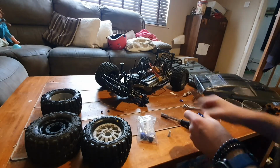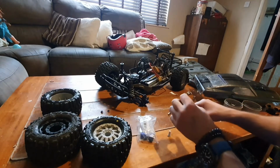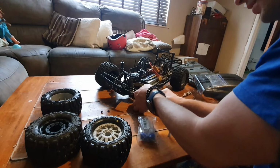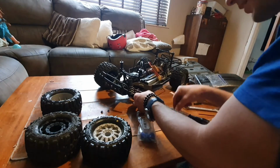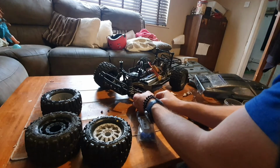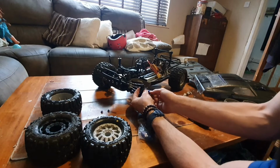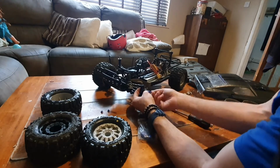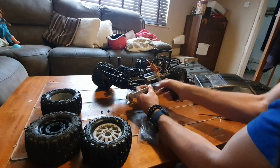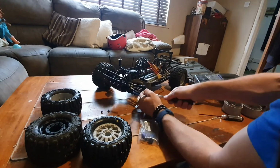So again, I'm not going to degrease that. I did degrease this when I was doing the kit. It shouldn't matter too much really. Just slide that back over, making sure that's really well seated and that sits an equal distance from the other one, which is good. Quickly just hand tighten that, just make sure that it's threaded on correctly. And again, we're just going to put the ring spanner around, 8mm socket, and just nip that up.